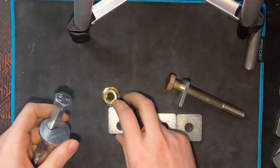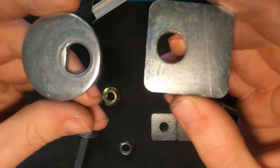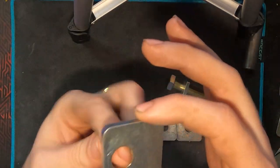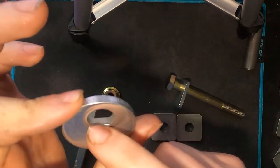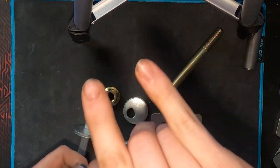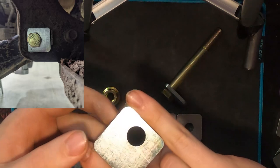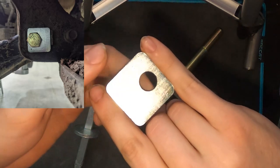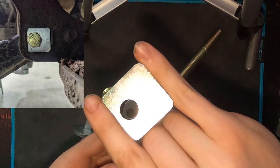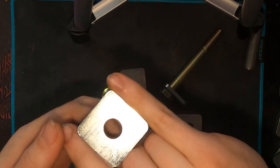Because these plates are rounded and not shaped like cam bolt washers, you gain some strength since there's nothing fighting inside like there is with cam bolts. The way the alignment works is those notches on your frame — you slide these plates in and it locks them in there. You have this setting which is your arm all the way in, and you pull it out and rotate it to push your arm all the way out. Or you can replace it with the center plate, which centers the arm within its alignment range.